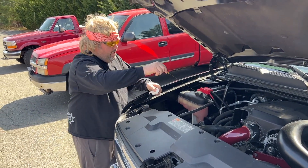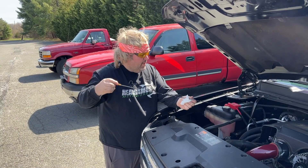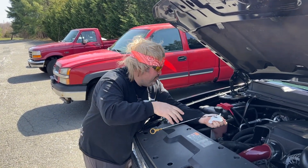I get asked a lot: is this expense needed? It's not really needed unless you're the person who doesn't change their oil often, runs E85, leaves it in all winter, or lets it sit for a couple months where it contaminates the oil, reduces film strength, and you just don't want to work on your car. In that case, it's worth investing in a DLC-coated bucket, no matter what camshaft material you have. If you're diligent about changing your oil, it's only going to reduce friction — it's not going to change your life.